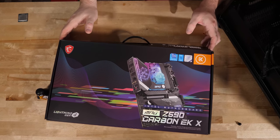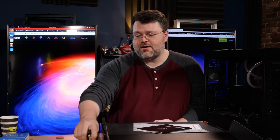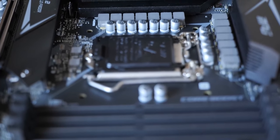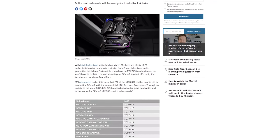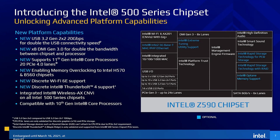This is a big motherboard box because there's a lot of stuff in here. The big change with Z490 was power delivery, but a lot of Z490 motherboards knew what was coming with Z590 and already support PCIe NVMe storage. The big change with 11th gen Rocket Lake CPUs and Z590 motherboards is they break out PCIe 4 for storage, for PCIe lanes, plus extra ones over 10th gen, as well as PCIe 4 for the GPU. No Z490 motherboard, to my knowledge, correctly supports PCIe 4 in the X16 slot.